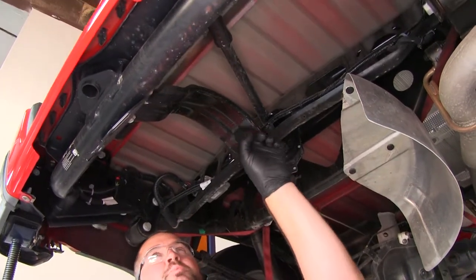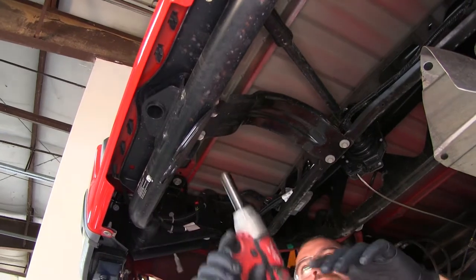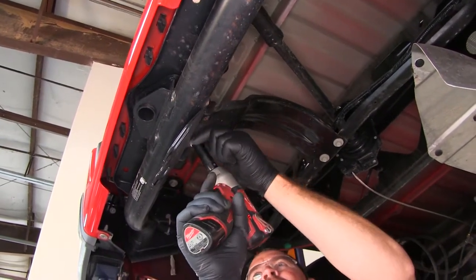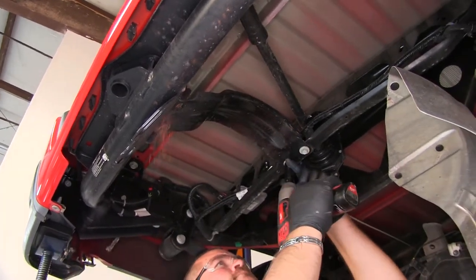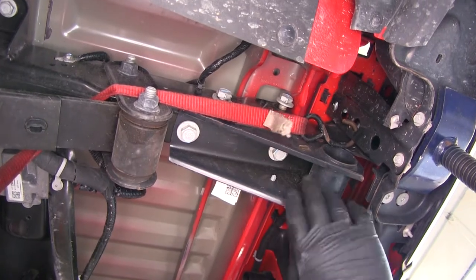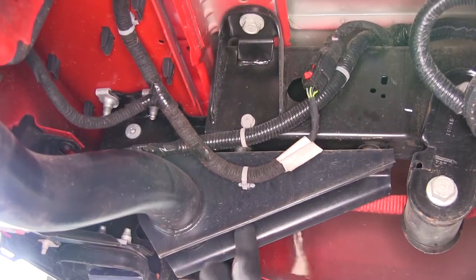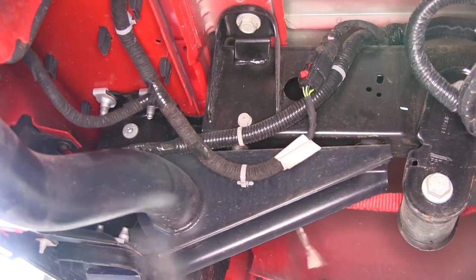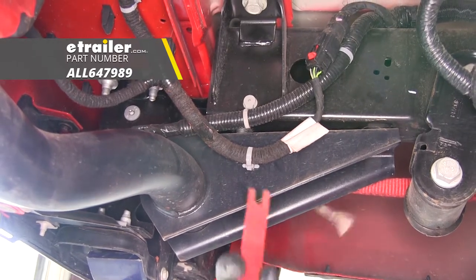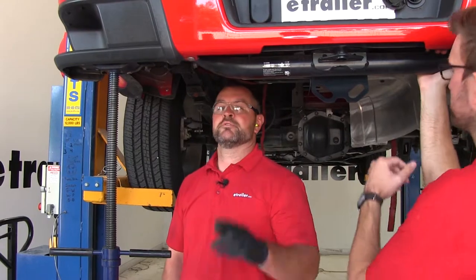With a 13 millimeter socket, we have our spare tire support beam here. We're going to loosen the two bolts and remove the two that are connected to this cross brace for our bumper beam. On each side of the vehicle we're going to have two bolts on the bottom of the bumper bracket or bumper support beam, and two on the outside of the frame rail — use a 21 millimeter socket to remove them. Leave one bolt in loosely on each side. There's also a wiring harness on the bumper support beam — take a plastic trim panel tool or a flathead screwdriver and pop that off. Now with an extra set of hands, remove the bumper support beam.